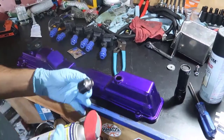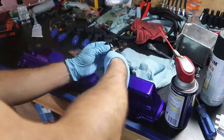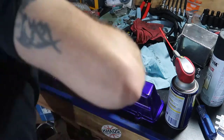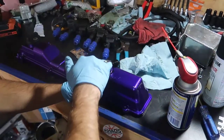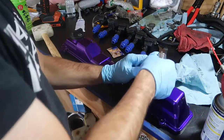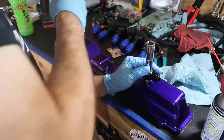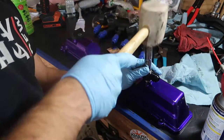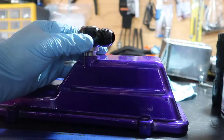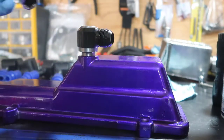10 minutes have passed. We're going to lubricate this part of the fitting and also lubricate the inside. I'm going to try to push it in, but if it doesn't go in, we'll use a 14 millimeter socket right in the center — it's kind of thick there, so that's where we're going to hit to make sure we're lined up. And there you go, it's going in. Now we need to keep it straight or it won't go in. I've got the 14 millimeter on it.